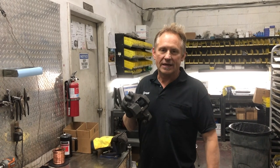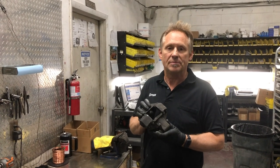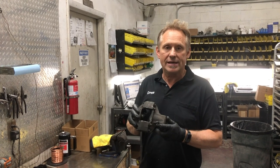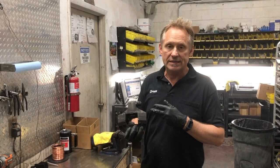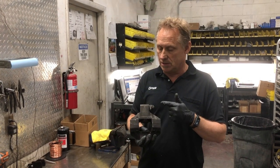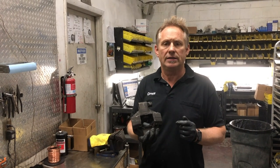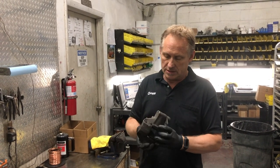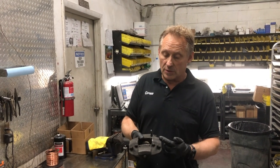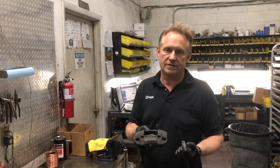Welcome to PMB Performance. We've done some of Ian Carr's calipers in the past, but those were for his 914. Today we're doing his Ferrari 308 calipers. If you're a 914 guy or a Ferrari 308 guy, you'll notice that the rear calipers are virtually identical — actually virtually identical to a 914-6 caliper. These have a 38 millimeter piston, slightly larger, and the Ferrari 308 has a vented rear rotor, so it has 10 millimeter spacers in the caliper halves.